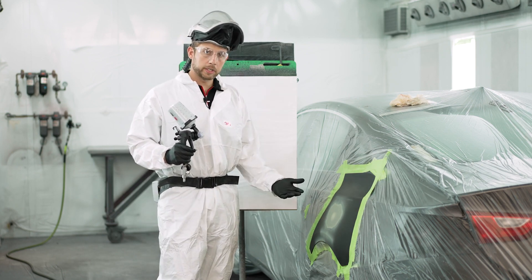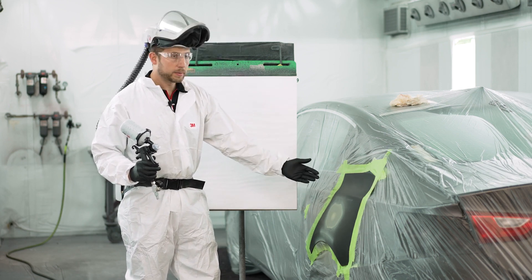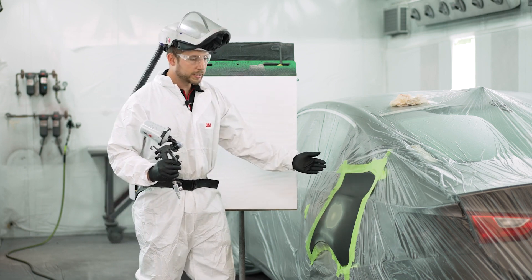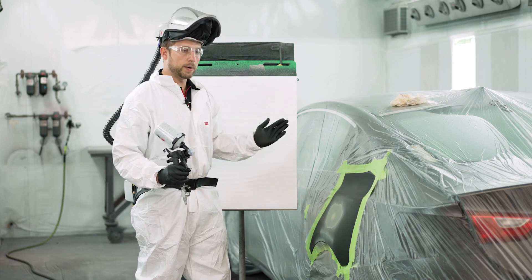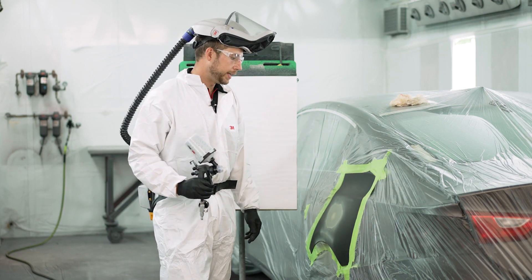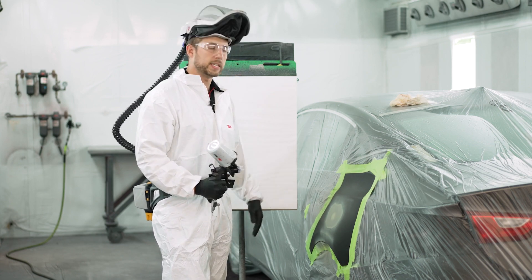While we're waiting for this material to flash, let's talk about the masking. On the leading edge of the quarter panel we've got it back-taped and taped pretty tight up to that edge. We did that same thing in the wheel arch as well as down where the quarter meets the bumper. You want it taped close to that edge because we're applying primer and you don't want it to travel too far around the edge — the next couple layers of coating need to cover that, and it also saves time in sanding. On the back edge of the quarter we rolled the tape over, which is called back masking, so if the surfacer gets close to that tape it'll create a nice soft edge, which also saves time in sanding.